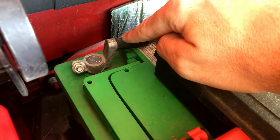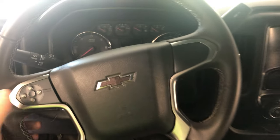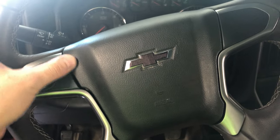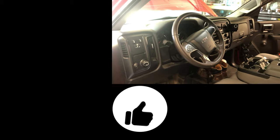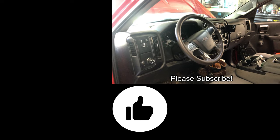Don't forget to reconnect your negative battery cable and tighten it down with a 10-millimeter socket. Overall I'm very pleased with the leather-wrapped steering wheel upgrade — it feels a lot better in my hands while driving compared to the hard plastic version. I didn't realize when I ordered this it was brown leather, so it doesn't really match the interior of my work truck, but I really don't care. The volume and seek buttons on the back of the wheel do not work — there is additional wiring required to get those to work. If you like this video, give it a thumbs up, and subscribe. Stay tuned for more videos.